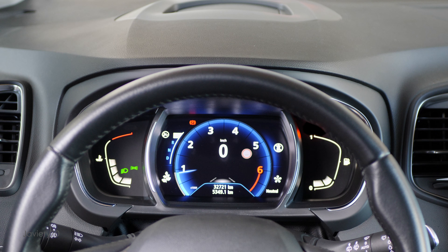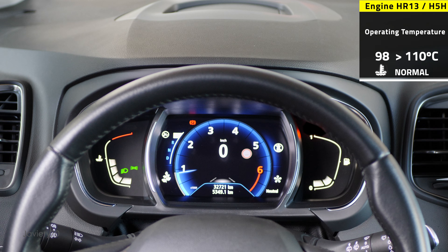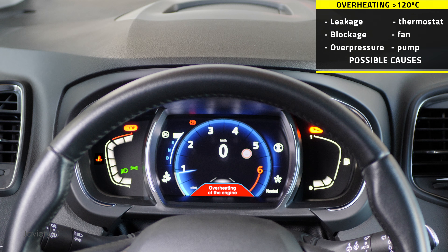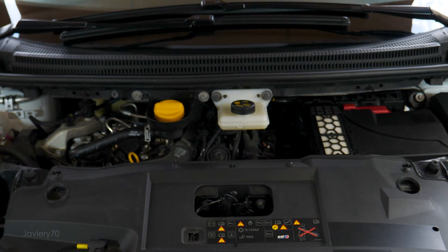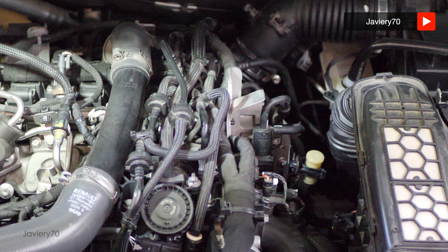The normal operating temperature of this engine is approximately 98 to 110 degrees Celsius. This corresponds to when the temperature gauge reaches its mid-range. If the cooling system is unable to maintain this temperature due to overload or system failure, the temperature will rise. If it continues to rise into the red zone, the engine overheating message and stop warning light will come on. To avoid serious damage, the engine must be stopped. When we open the bonnet, we see that the coolant tank is empty. We look in the engine for a leak, especially on the upper right side where the thermostat box is located.